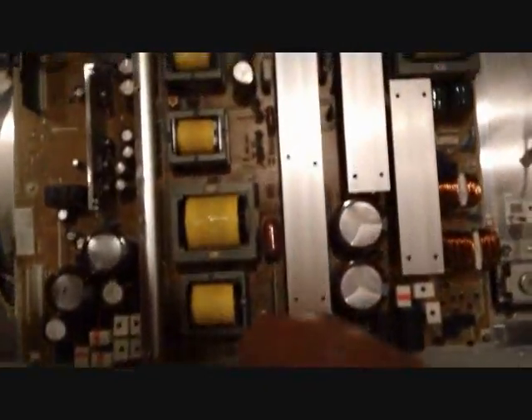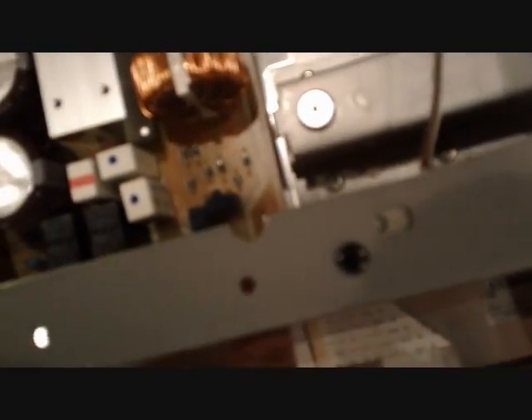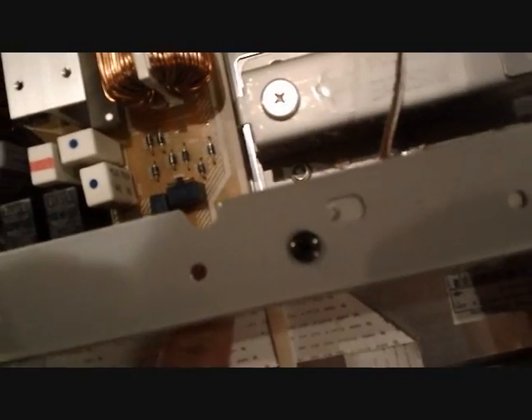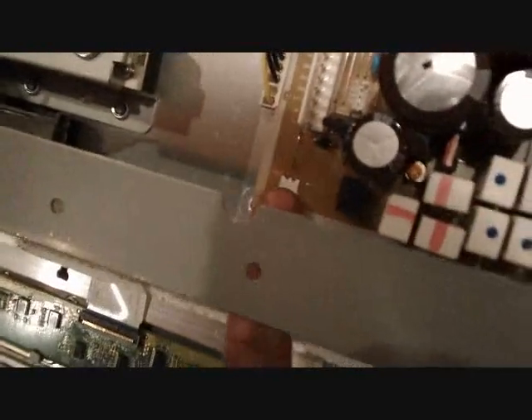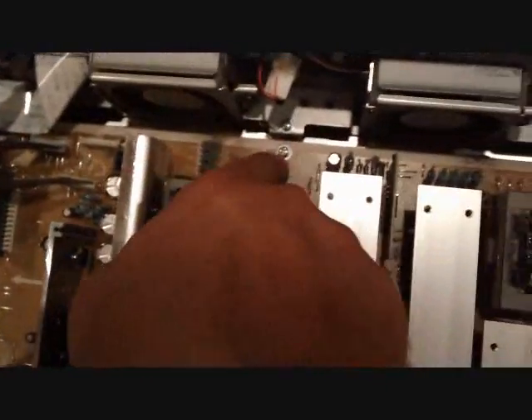Now all I have to do is remove the screws. We have six screws — one is hidden under the ribbon cable. In the center there are plastic standoffs which sometimes you have to squeeze with pliers to release the board. I want to note which screws go where because they're different. The screw from this corner has marks left by a star washer — that's a grounding screw that makes an electrical ground. The same applies to the one in the other corner. This one has a plastic washer as an insulator, and the three across the top are identical with regular flat washers.